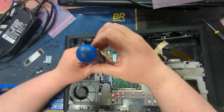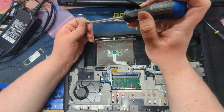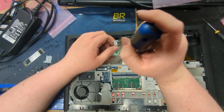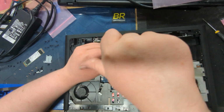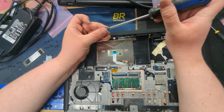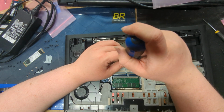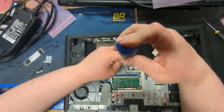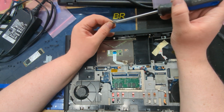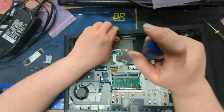Neodymium magnets are great. Old iMacs, if you tear one of those down, you get those from the corners of the glass. It's usually like the 2008 to 2012, I think. And then they started doing all that tape nonsense. Tape is terrible to use in a screen like that. I really don't like that because it made it not just harder, but so much more wasteful because it was no longer a toolless removal. You could use your fingernails literally before. Now you have to use either a spudger or it's a destructive method.